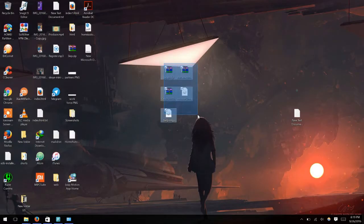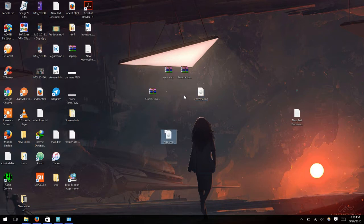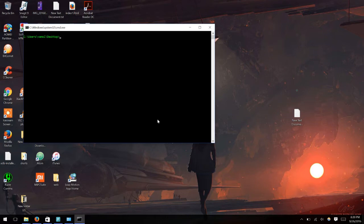These are the four files I'll be using: the official OxygenOS 3.2.4, the official recovery image, the custom TWRP recovery image, and the custom OS which I'll be installing once I revert back to the official 3.2.4. To open the command prompt in the current working directory on your desktop, hold Shift and right-click your mouse — you'll get an extra option which is 'Open command window here.'